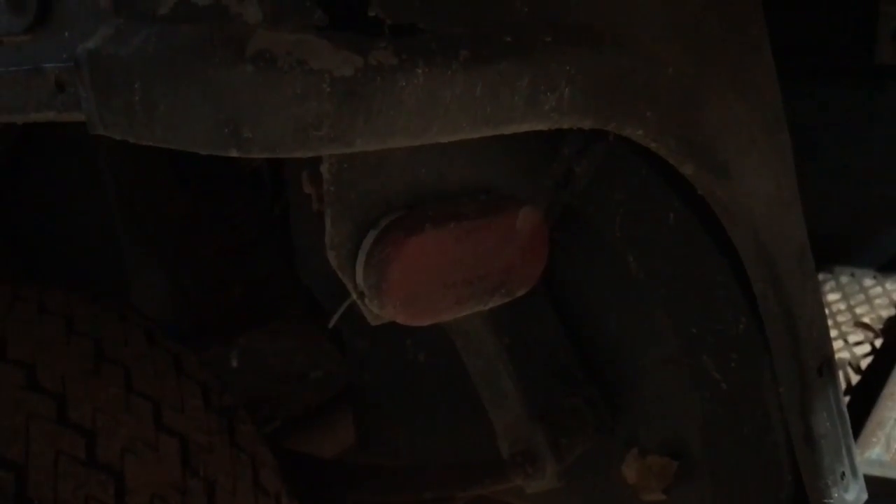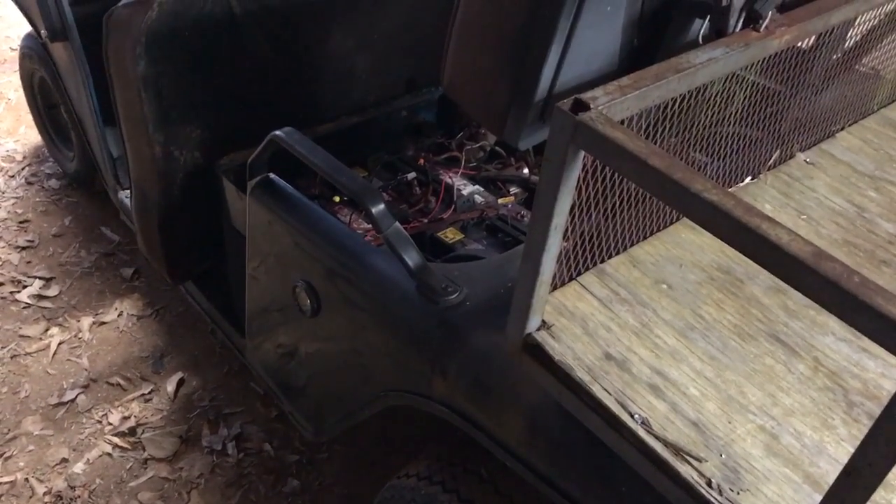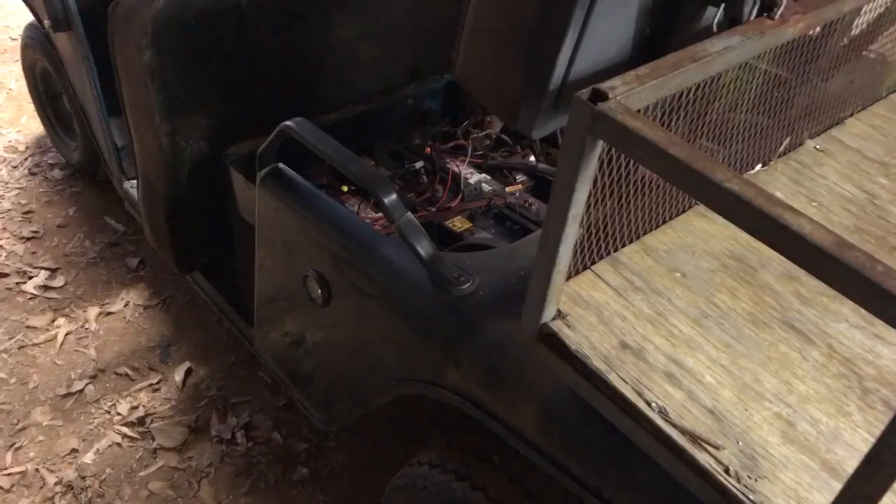On the back I've got this old red light — wires aren't hooked up to it — and I'm going to change it out for an LED light too, because LEDs burn a whole lot less power. With it being an electric golf cart, I prefer to have LEDs so it ain't drawing so much power off the battery. One thing you have to do is make sure you have everything wired up right. A lot of these lights are made for utility trailers and they only have one wire for the hot, and they ground through the bolt. Since the golf cart is 36 volt, you cannot ground to the frame through the screw hole — that would be getting 36 volts. You can get voltage reducers that wire into your golf cart to turn that 36 volt to 12 volts.